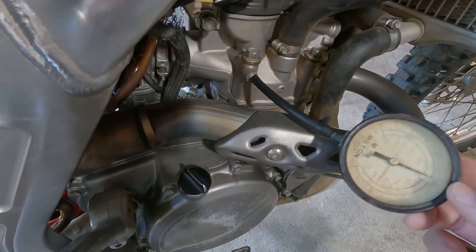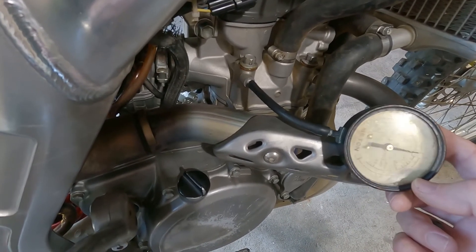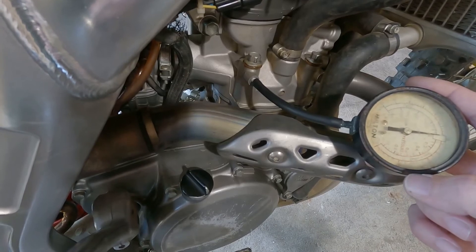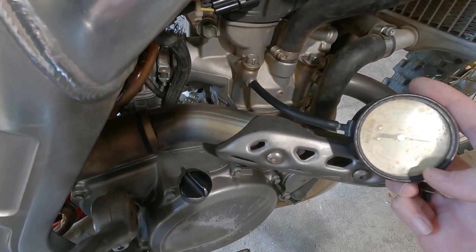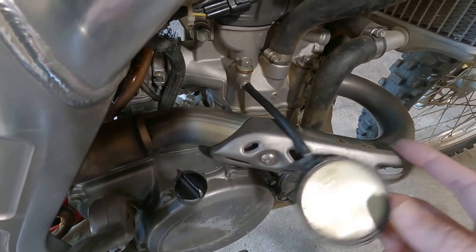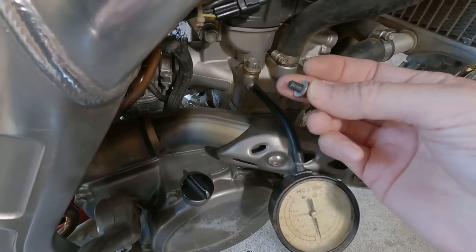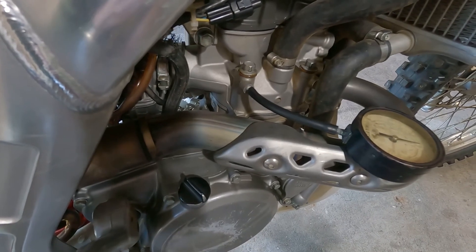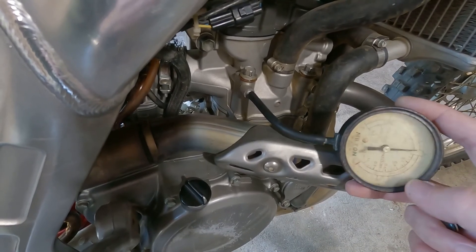I just wanted to test this and make sure the oil pump is pumping — and now I know it's pumping, so I'm sure it'll be fine once it warms up. That's how you make the setup: use a short little hose, find a gauge rated about 15 to 20 psi so you can read the markings clearly, since warm pressure will be around 2.8 to 3 psi. Thread the fitting into that little screw hole, don't overtighten it, and there's your little setup to check oil pressure.